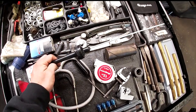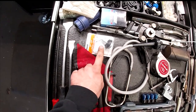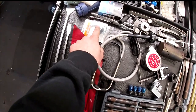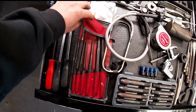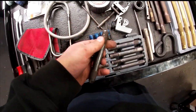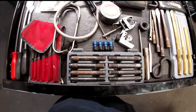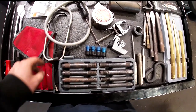There are some miscellaneous chisels, probably for brake lines. There's a terminal removal tool that also works for wiper arms — just a big piece of brass to hit. A Snap-on measuring tape — probably the nicest measuring tape I've ever seen. Valve core depressors for letting air out of tires without removing valves. A stethoscope for listening to bearings and miscellaneous noises, and a universal drain plug kit.